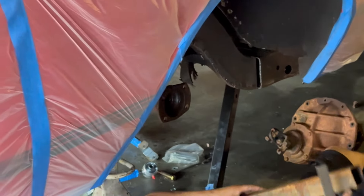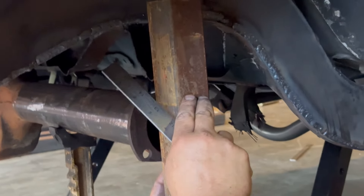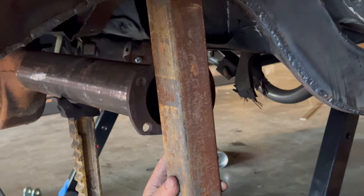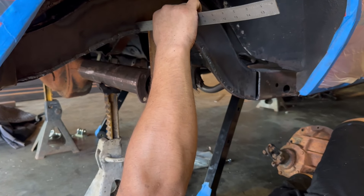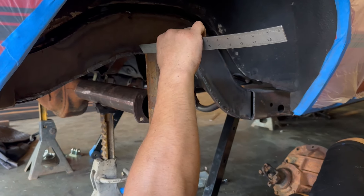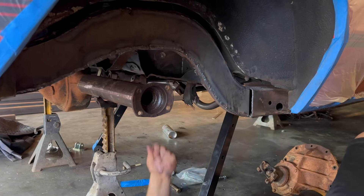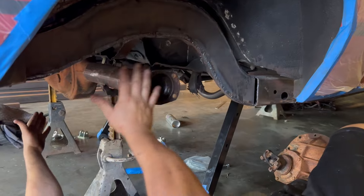It's going to have to be off-center, because from here to the flange it's two inches. So if I put the axle in here and bolt up the wheel, the wheel is going to hit right there. It would be two inches there, then one and a quarter, that's three and a quarter, and then the thickness of the rotor. So it's going to have to be off-center about a half inch. The main thing I wanted to find out was the offset.